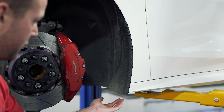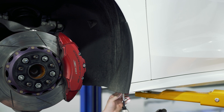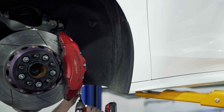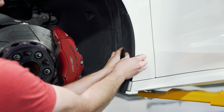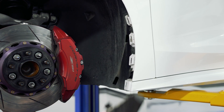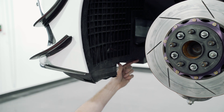You have three 7 millimeter screws here for the mud flap and fender liner that we need to remove. Get those off. Pull this mud flap off starting with the bottom corner here — you just have to kind of firmly pull it out. Then we've got three T15s on the bottom here: one up through this air deflector and then two over here.